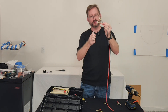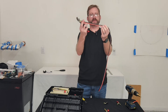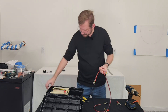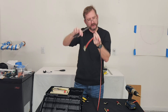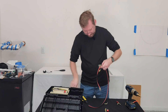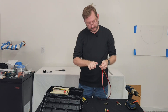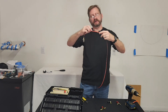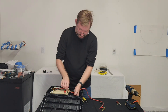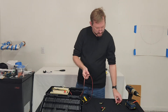We've got this in, and these are heat shrinks, so I'm going to mount those down. I'm going to split back the negative right here so I can put the shunt in line. It's good to try to get the terminals oriented the right way so that you don't twist them when you put them on. Battery is here, shunt to here — I'm going to heat these and shrink them down. I'm just going to lightly screw these down on the terminals in the shunt. I've got a little bit of extra, so I'm going to cut this off and put the ring terminals on for the binding posts.